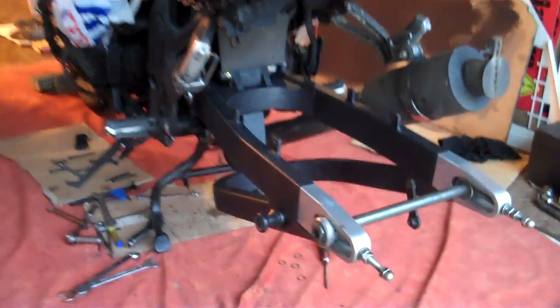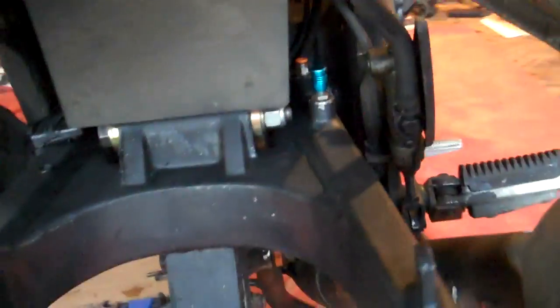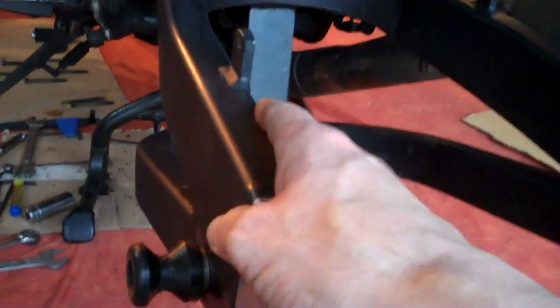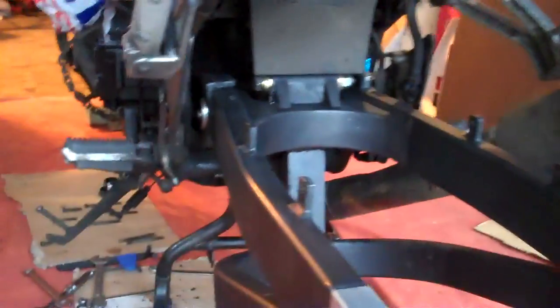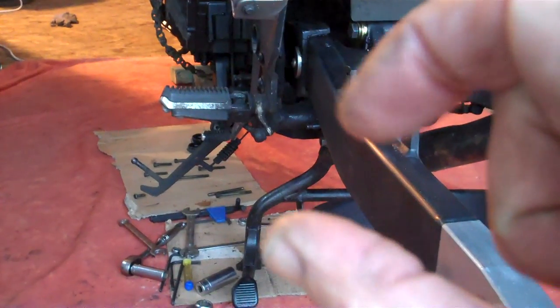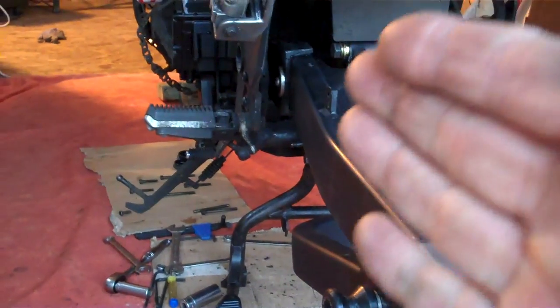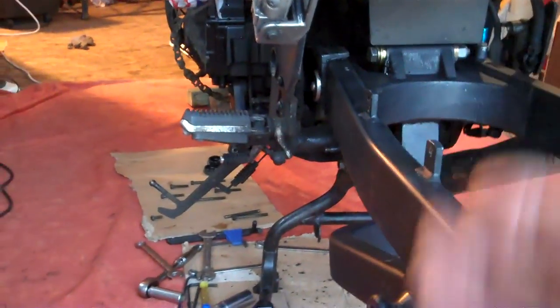Right, 2 hours. And there it is. Puffing and grunting. It didn't want to go in because, contrary to the eBay sale listing that it's for a Bandit 1200, it is a GSX-R11 because it said so at the front. And this width across the top was 2mm wider, and it just wasn't going in. I managed to lever it in with the bar of doom, but it then wouldn't move much. So out came the lapper, and I just took the powder coat off the inside of the frame and took the alloy shoulders just off the outside of those two fittings, and gradually, 1, 2, 3, 4 different faces, just a little lap on each face, half a mil off each, and it's slotted in perfectly, so that's fine.